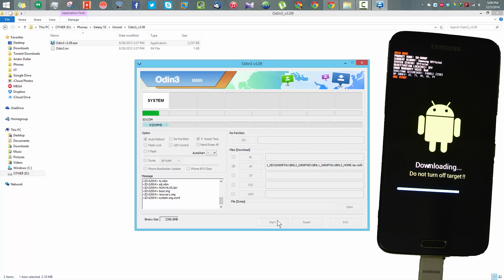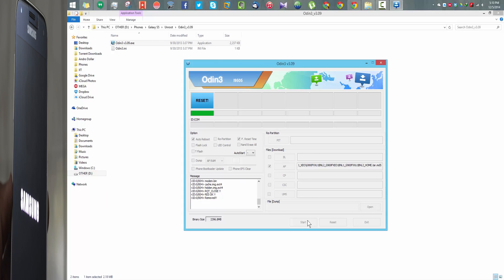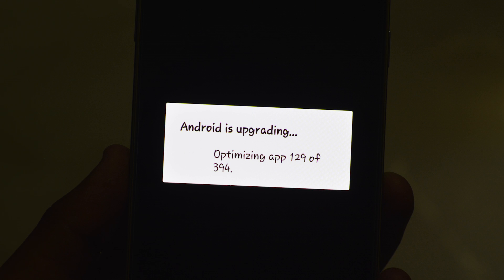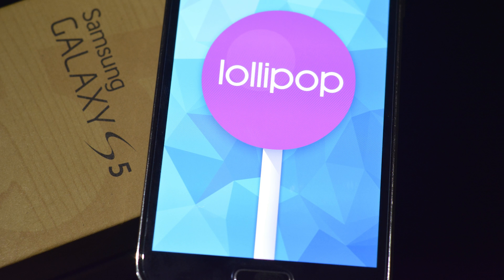While the firmware is being installed, your device will show 'Downloading' with a progress bar processing the file. Once the file has been processed completely, it will say 'Installing' and the firmware installation will begin on the device. Once Odin says 'Reset,' unplug the device. You will then see it installing, and after the installation process the device will reboot. After the boot animation is complete, you will see a message saying 'Android is upgrading' as it optimizes the apps. If you have a lot of apps it will take a long time, but after that the installation process is complete and you are now running Android Lollipop.